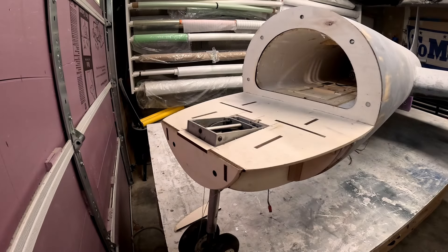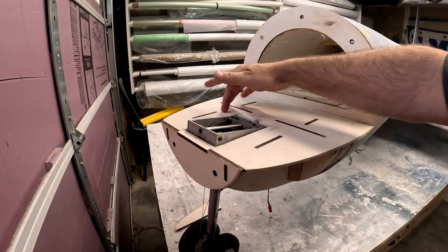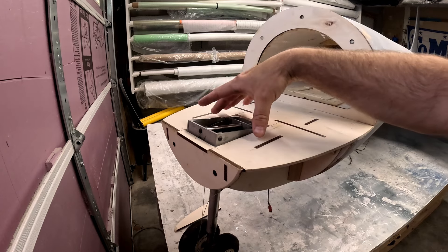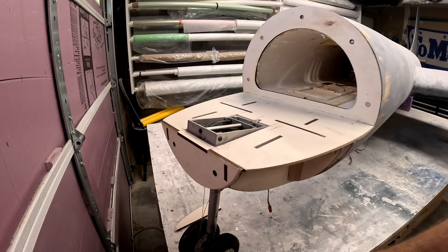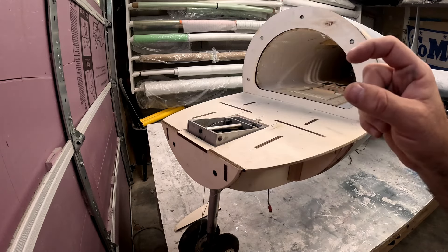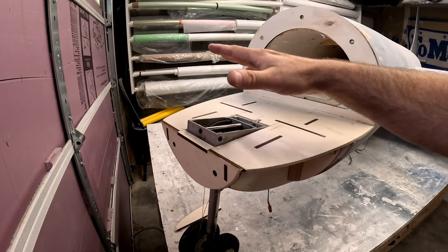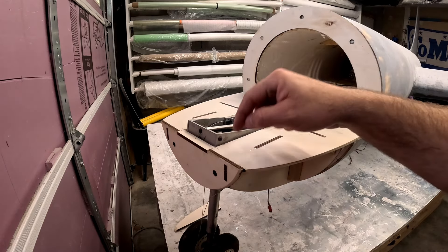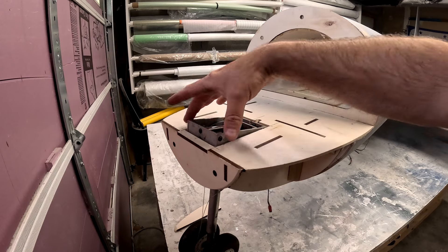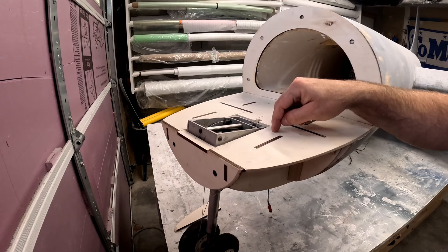It's a new day and a fresh mind, so let's get back to work. Last thing we did was epoxy the upper doublers for the nose gear box mounting rails and also epoxied those maple doublers to the actual plywood mounting plates. All that stuff has been curing overnight. I've got the retract back in here, and while we were under there yesterday I very loosely drilled the positions of the mounting bolts inside the plywood rails.